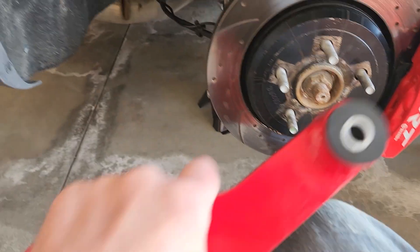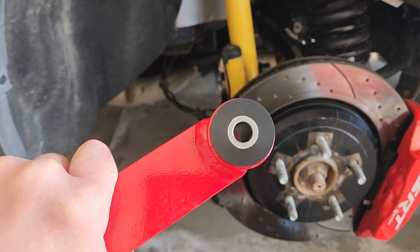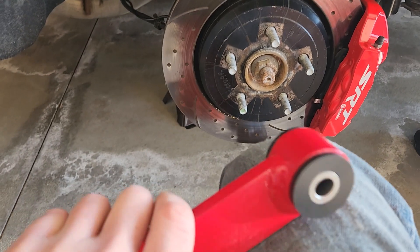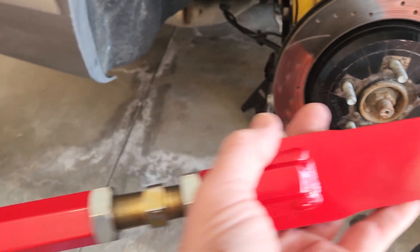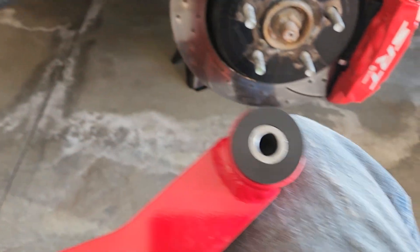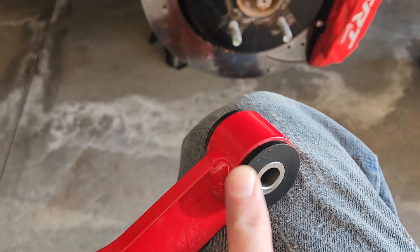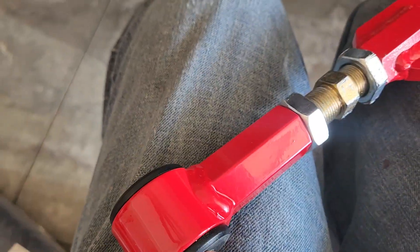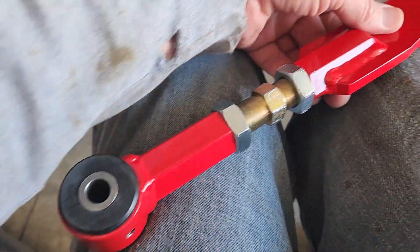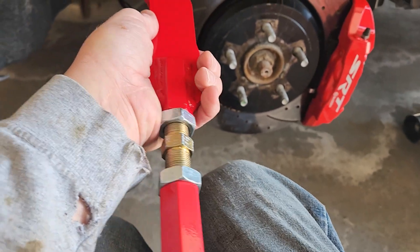I bought the hybrid. They come in three versions: polyurethane bushings, hybrid, and Delrin, which is high performance — you only get the Delrin bushings if you're running like 900 horsepower or more. So I just got the hybrid. This side is real strong Delrin — not polyurethane — so it goes on the frame side and will be nice and sturdy. But the other side is the softer polyurethane rubber, so it'll be quieter and won't make as much noise on the road as a pure Delrin race application would.